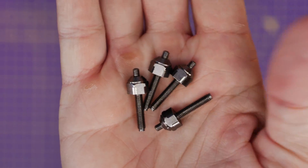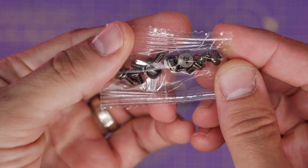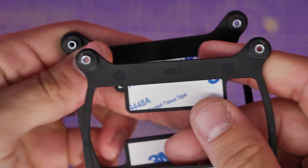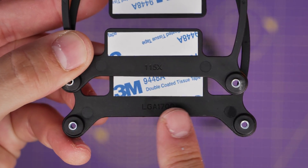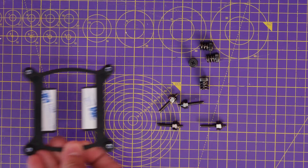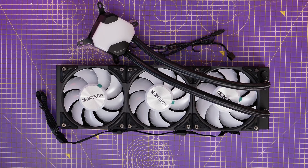The installation of this cooler is really straightforward, and interestingly the wiring logic of the fans is quite similar to Phanteks fans. Then you have a bag full of tiny screws to secure the radiator to the case. Included in the box are two different brackets for the rear of the motherboard: LGA 1151 and LGA 1700. We're going to use the LGA 1700 for the newer Z790 motherboard. So your four standoffs, your thumb screws and your rear bracket, which has 3M tape on it that you'll need to use to secure to the motherboard.